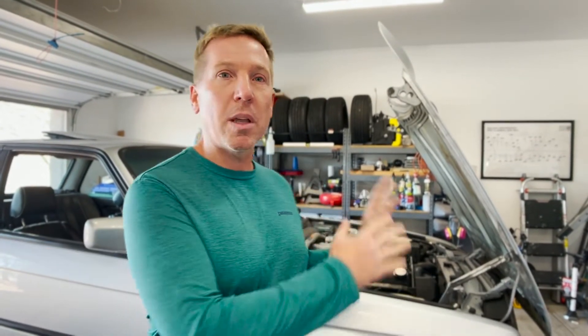Day two — it was getting late last night, so I stopped and filled the car up. I want to talk real quick: the big thing about my channel is I drive cars really hard, but I also teach you how to work on them. So if you own an E46, M3, or E30, frequent oil changes are essential. As I mentioned in the last oil video with the rod bearings and the M3, every 3,000 miles. Same thing with this car — probably every 2,000 to 3,000 miles. Nothing longer than that.